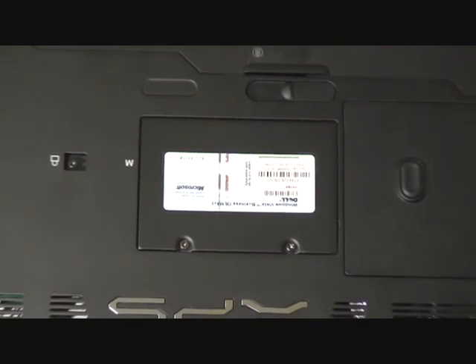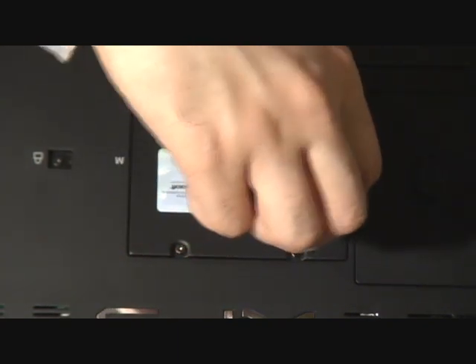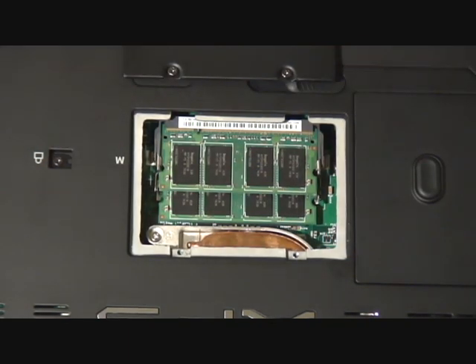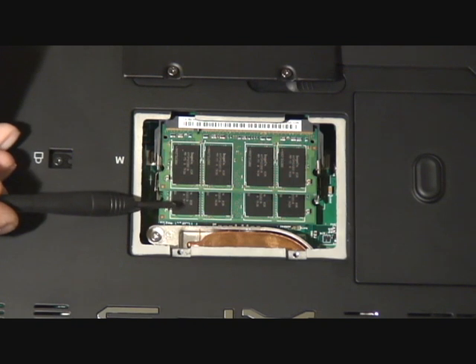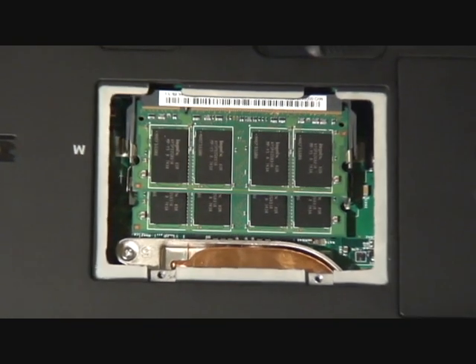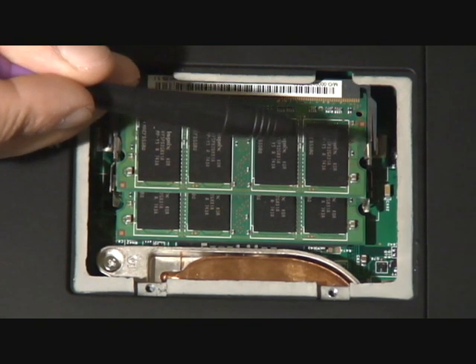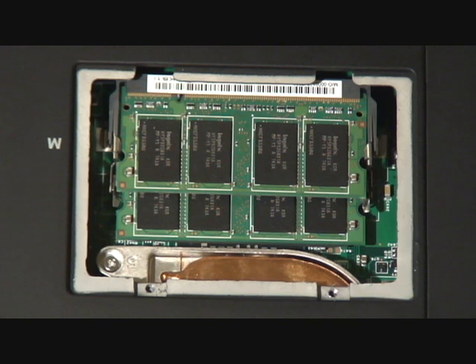There's no RAM chips under the actual keyboard. I'll quickly open the panel up so you can have a look. There are just two screws holding the chips in place. If I take that off, you've got two RAM chips — you put your first one at the top and your second one just underneath. In this particular model we've got four gig of RAM, so both of these are two-gig sticks. You've got your normal brackets on each side and two levers which you pull apart to take the RAM chips out and replace them if you wish.